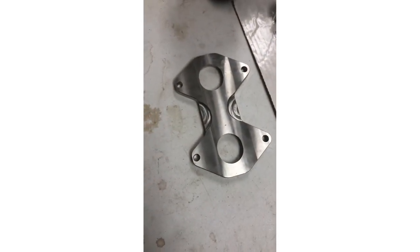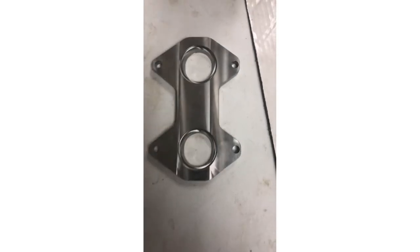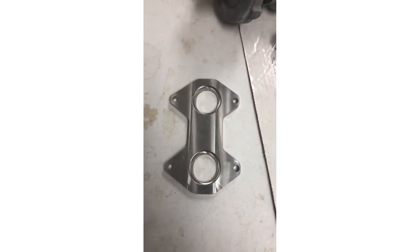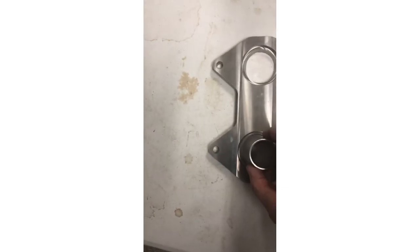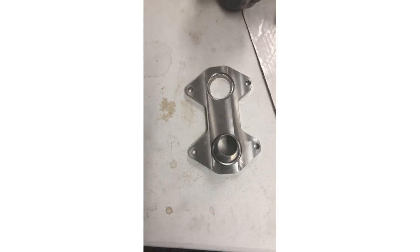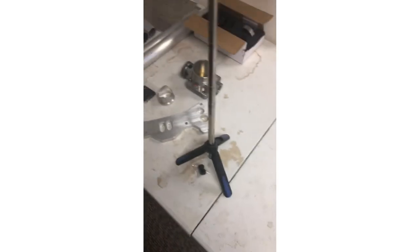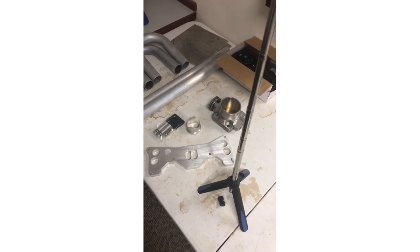Here is my exhaust manifold plate, which also came in. I didn't want to have one specially made because it costs a lot of money. These come with a two-inch diameter, but from talking to Mazda automobile experts, they typically neck it down to one-and-five-eighths. So I got these reducer cones I'm going to weld in, which will bring it down to the one-and-a-half inch I'm running. I also got these steam pipe fittings, all in stainless steel, some 45-degree bends. I'm now ready to start mocking up my intake and exhaust manifold — starting with the intake manifold first so I can get it in place on the engine and make sure my turbo is mounted in a clear, unobstructed position.